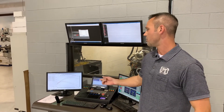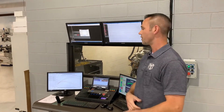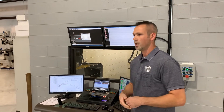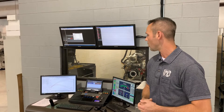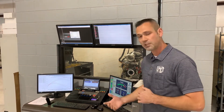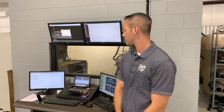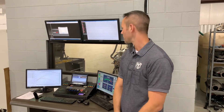Those are real results — two different days, but same dyno, same engine, as many similarities as possible. The Trick Flow headed engine took about one and a half more degrees of timing than the LS3 headed engine, so very similar timing curves, same pump gas, all things being the same. We saw a 26 horsepower gain and a 15 foot-pound gain with the LS3 head over what many would tend to think would be a higher torque number with the cathedral port due to higher velocities and smaller port. To the contrary, we're seeing that the LS3 basically annihilates the cathedral port. I know which one I want in my race car — which one do you guys want?